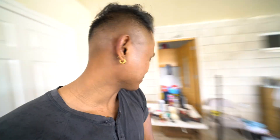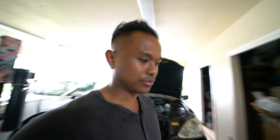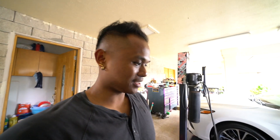Got the other side done. Honestly it was a pain — a little tighter like I said it would be. Changed the plugs, got everything done. Had to run to O'Reilly's real quick because a PCV hose broke — it's all brittle. Bought a new PCV hose and I'll just cut it to length; it runs right here and goes to the intake. Already filled the engine oil, tried to fill the coolant — going to let it run and top it off while it's running. Going to put this intake manifold back and try to start it up.